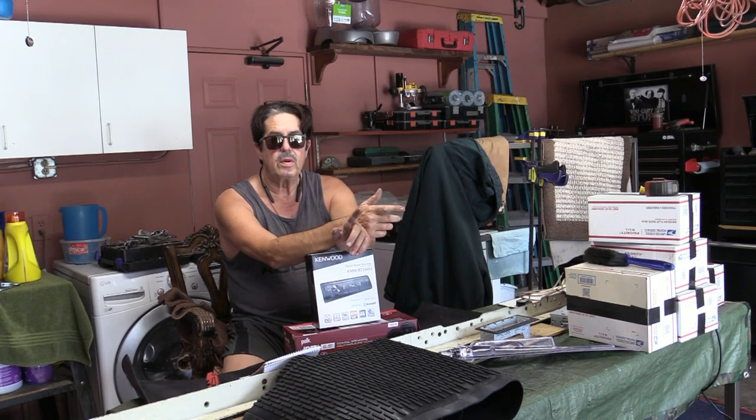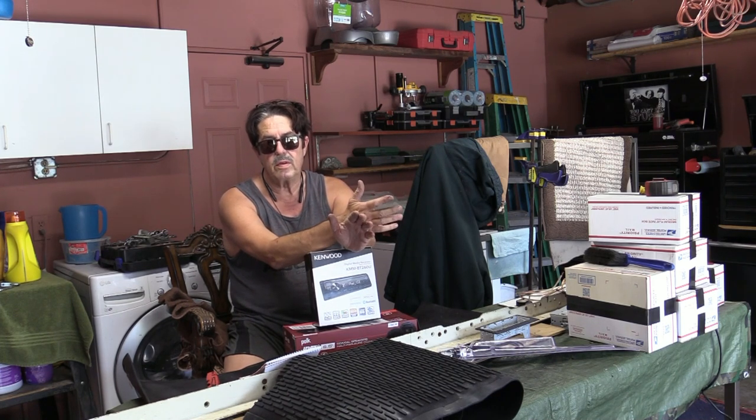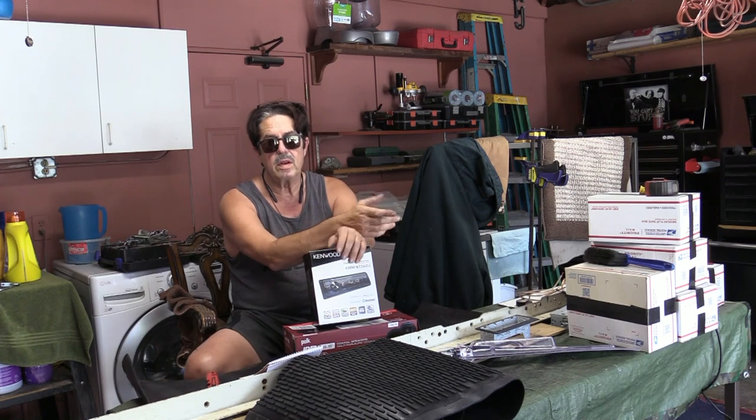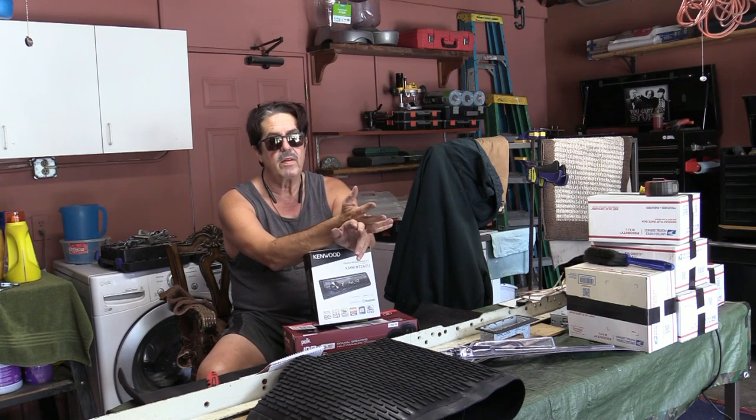I have an Astro canister filter and two inline disposable filters — I'll leave a link below for the disposable ones. You could probably get away with just the inline disposable filters and a smaller compressor. To dial in the 28 PSI, I took a piece of cardboard from an Amazon shipping box, put paint thinner in the gun since it was about the same consistency as the paint, sprayed it, and adjusted the pattern until I liked how it looked with minimal overspray.